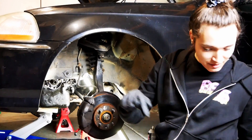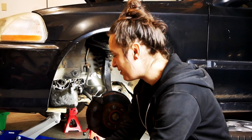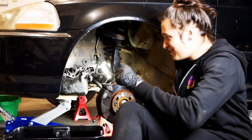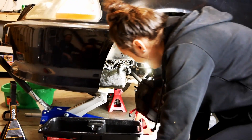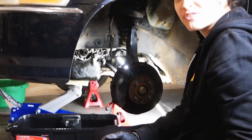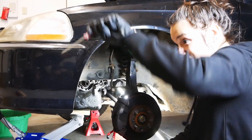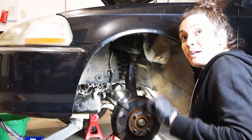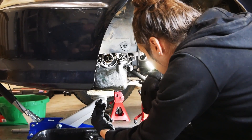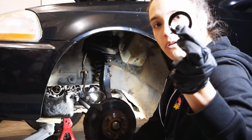First I have to find my pick and pry out the original seal. I have no idea how much oil is going to come out so I have a catch pan underneath. With a little extra persuasion to get the flathead screwdriver in between the seal and the oil pump, you can lever it out — I found a gap at the bottom. It's not under pressure right now so no oil shooting out, which is good to know.